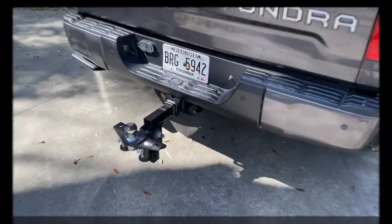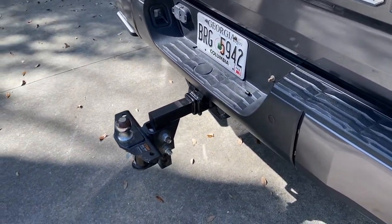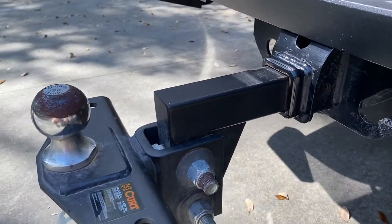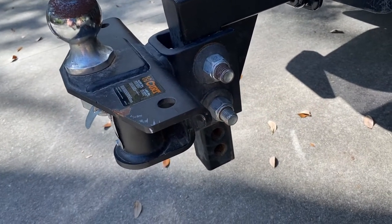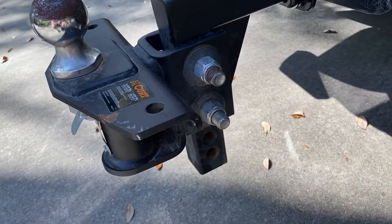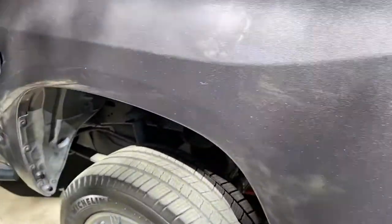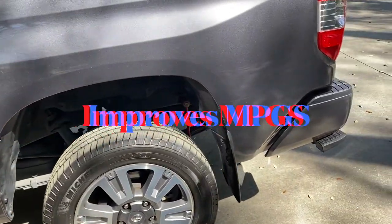Setting this back down — this is a Curt round bar hitch and I have arms rated for 14,000 pounds, though I never tow anything that heavy with my Tundra. Right in here are little washers, and depending on how many you have, it puts tilt in your hitch — that determines how much leverage is lifted back onto the front end of the truck. The most important thing to note: you don't want to set your hitch then inflate your bags until you're level. You always want to set your bags first. For me it's about 30 PSI, which is where my truck and travel trailer sit level and ride nicely together.